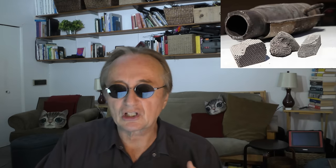There's a lot of reasons cars can't rev up too high. If the catalytic converter's clogged, it'll do that. Toyotas aren't known for that. If the fuel pump's weak, well, the older Toyotas like that aren't known for fuel pump problems. That's a new thing that they made something wrong and they got to recall a bunch of them, but that's newer than yours. I fixed one a couple months ago with the same exact problem.